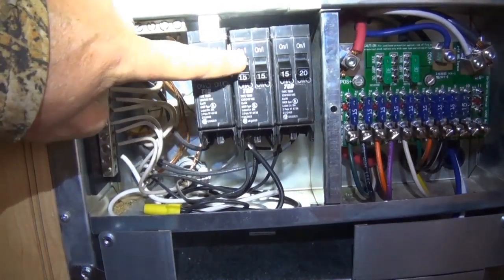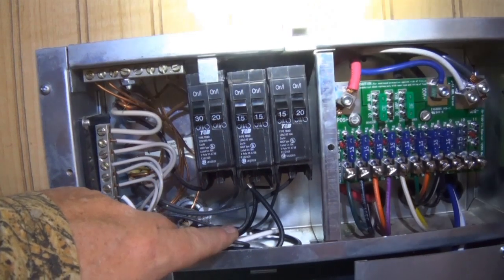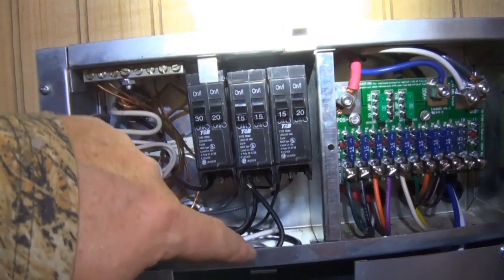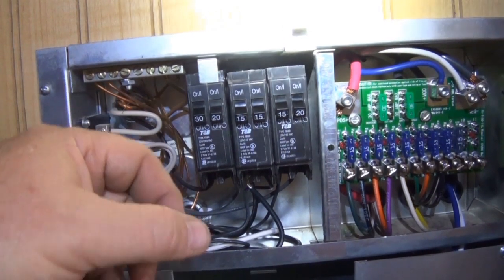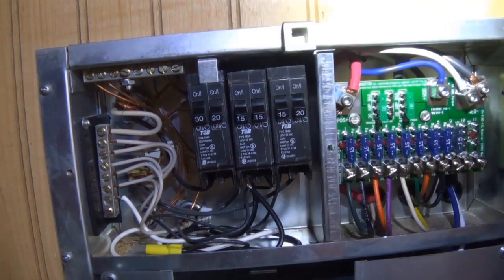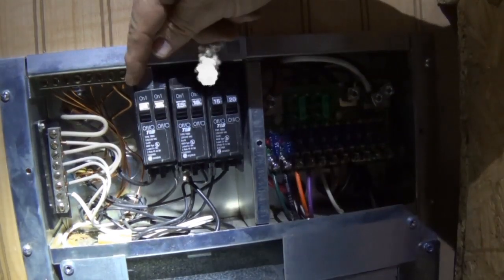So now over here on the AC side, I put the right one there. I got everything all done. This guy here is up inside nice and tight. And then after a few months I'll come back in and make sure these guys stay tight. When I pulled these out, I also checked the wires, because they're stranded wires and real thin, and I didn't want them to break off and have half of them broken off, because if that's the case, then I'll just have to re-strip the wire. So that's about it. Let's go ahead and get the hole drilled and see what we can do from there. We are done. I see no smoke, no fire.